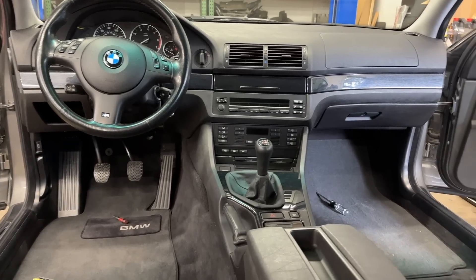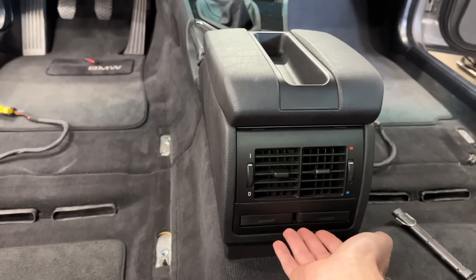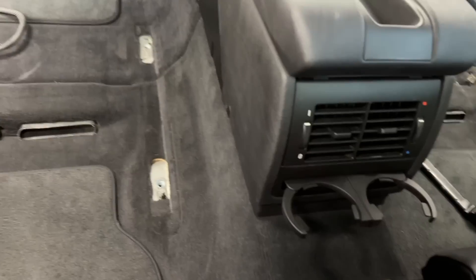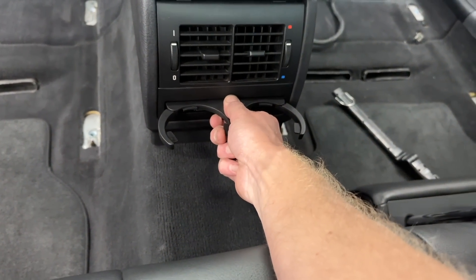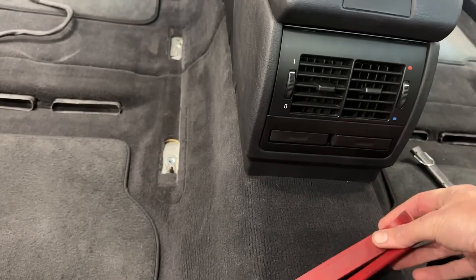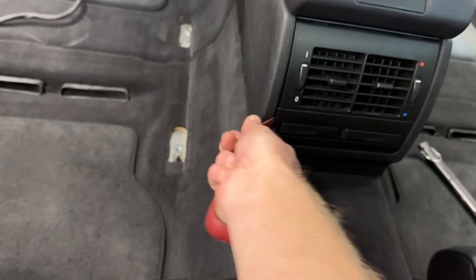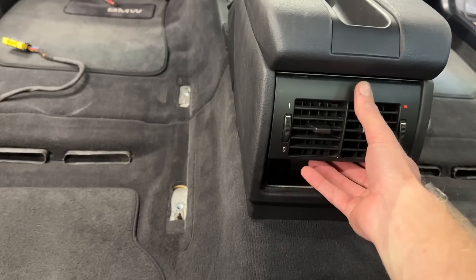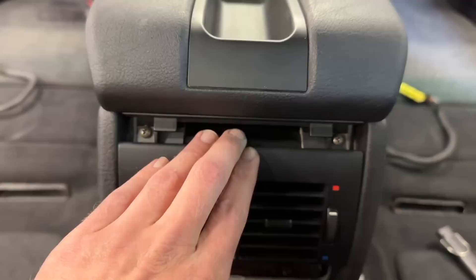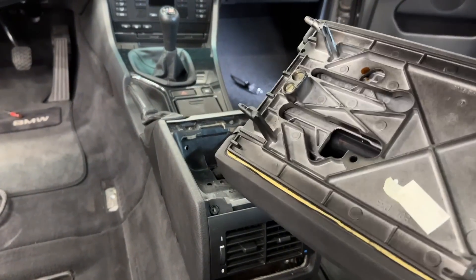The wiring actually begins in the rear of the E39. If you have a storage cubby, shove your hand in and pull up — it's held in with clips. For rear cup holders, open them halfway and use a plastic non-marring pry tool inserted between the vinyl and the plastic cup holders and pry outward. Next, slide the vents down to access two small Phillips head screws, remove those, and pull the armrest back. With the armrest out, two more Phillips screws are exposed.